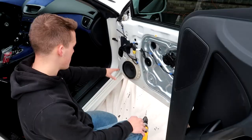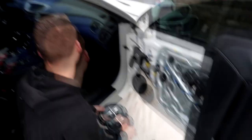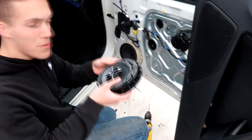So this here is the stock basket and then the stock speaker. And I'm going to be putting in the new basket, which as you can see is a lot thinner, because the aftermarket speaker that I got is a lot bigger. So it's going to sit like this — you need to put in the new basket. You might be able to get away using the stock basket, but I'm going to be taking it out because the bracket supplied should fit my car. So the first thing I'm going to do is unplug it right from here and throw this off to the side, because later on we're going to have to cut this and splice the wires.